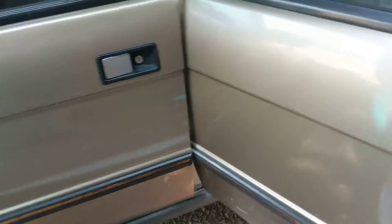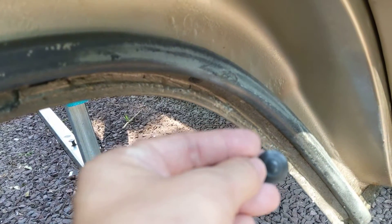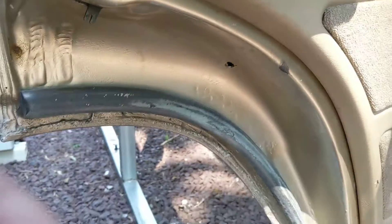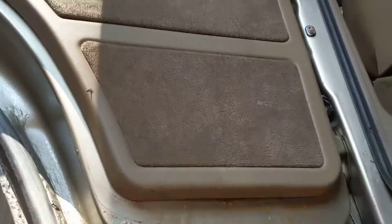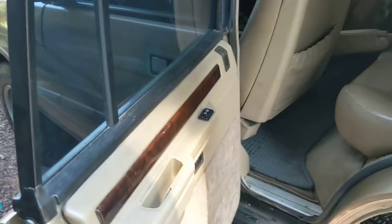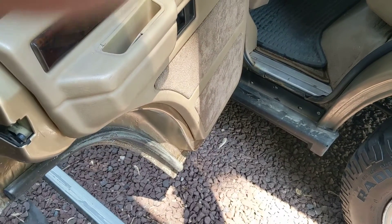Specifically, what I'm going after — this Classic had possibly, I don't know if this is from the manufacturer, but these holes with these little black tips over them. I'm going to be able to spray into this cavity because, as you can see here, there's rust right there. And if you get down low, you can see a fair amount of rust under the door. What that tells me is there's definitely oxidation happening inside of this door. So, I'm going to hit it with the wax oil cavity fill.